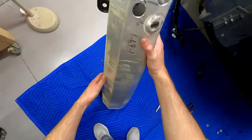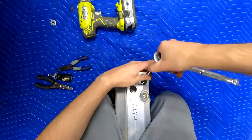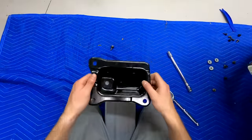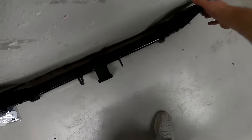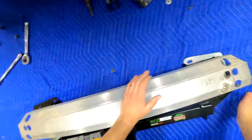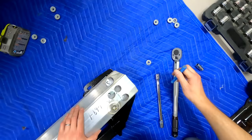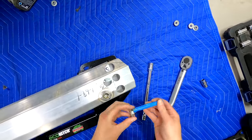Pull that right off. The next step is to remove those frame bolts - let's see how easy this is going to be. They come right out. That looks like the mount for the tow bar - yep, that's it. We're finally at the point where we get to put stuff on! We take the hitch and line it right over those holes, then use the factory nuts to bolt it on at 38 foot-pounds. You need a torque wrench set to 38 and when it clicks you're done. It's a little tricky getting the nuts on, but if you use a magnet it helps. Line all these up first.